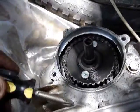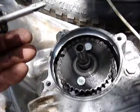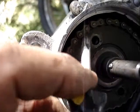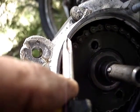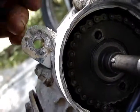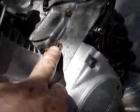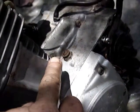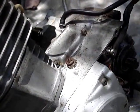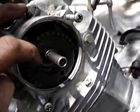Because this engine is seized — I think it's oxidation — we're going to pull the two bolts off and worry about reality later. There's actually a little O that would line up with this little hash mark, but this engine is locked, which we just happen to be in almost the correct position. So you've got some valve lash on both sides. You're going to turn this clockwise to get the cam chain loose, and then the cam should pull forward easier. When you turn that screw down clockwise, this will come right loose.